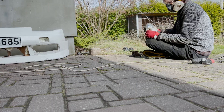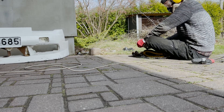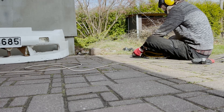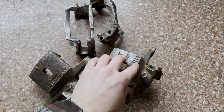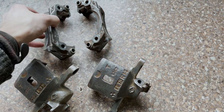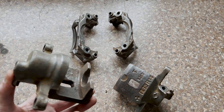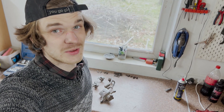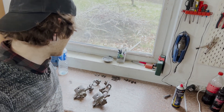Once again I'm wearing a full hazmat suit, and I've been so thankful to myself for doing it. When I was doing this type of work at around 20, I was out of breath all the time from the rust dust — that wasn't good. Caliper update: they're looking a bit better and you can see the steel color. It's quite difficult to take the rust off with a wire wheel — sandblasting is definitely the easiest way. I thought I could use some kind of chemical rust remover, let that soak overnight, and that would be way easier than spending hours on removing rust with the wire wheel.